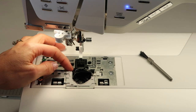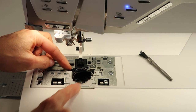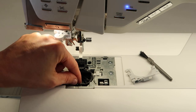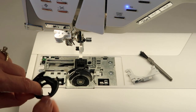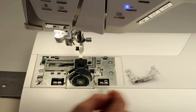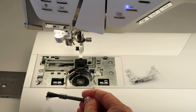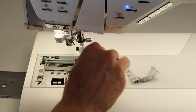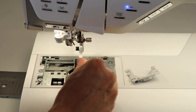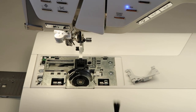There are two more things to remove. You'll notice a U-shaped piece that sits over the bobbin case — it sits nice and flush — so set that aside. Then the bobbin case will completely lift out; this is the part that clicks in when you load your bobbin and provides thread tension. Down in this whole area is where all the lint gathers, and that lint can cause skipped stitches or thread breaks, so get in there and clean everything out. Doing this every couple of bobbins will make the machine run smoother and last longer.